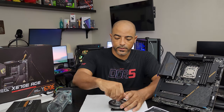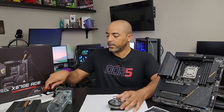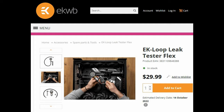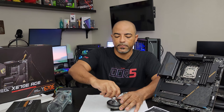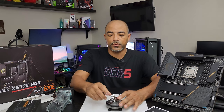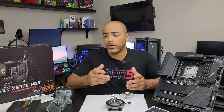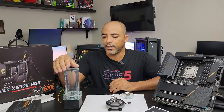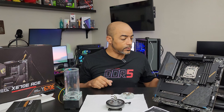This is basically going to be short runs. I like to use distilled water for my leak testing. Some people say they really enjoy using an EK air pressure kit — I don't like those at all. If I was mass producing water-cooled PCs, sure I'd use that kit and it is reliable, but there's really no substitute for fluid actually going through your system. All the vibrations of the fluid trying to find a way — because water will find a way. This pump right here is a pump/res combo by Optimus. It's pretty diesel. I really like this. I used this in my previous flagship build for about a year and it was just powerful.